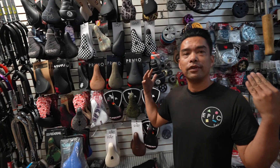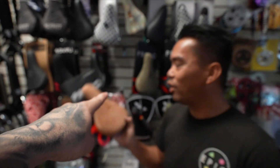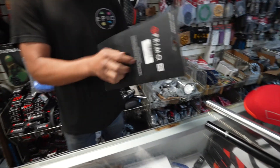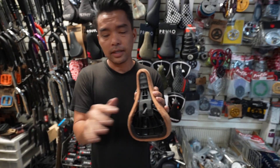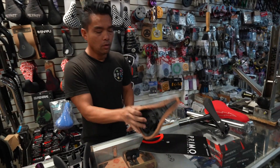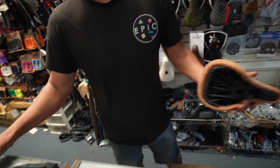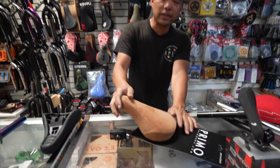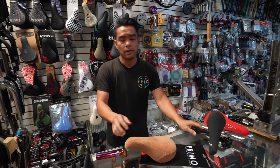Let's roleplay - you're that kid. Pick a seat. The corduroy - okay, you like the retro stuff. I want this one. Unfortunately, you can't use this seat - it has a pivotal system, look at this ratchet system. Remember what I told you guys? It's a different type of seat. Because you've got a fixed post, there's no way to get this out. So what do I need to do? You need to get yourself a pivotal post. See how it has that? You need that. The seat itself and the post have to go together - you can't just get a post without a seat. Remember, you're getting rid of a seat and seat post, so you have to get both. You need a pivotal seat and a pivotal seat post.